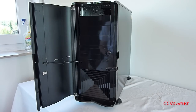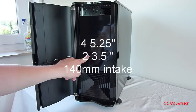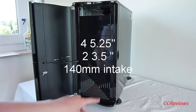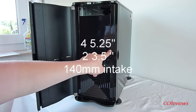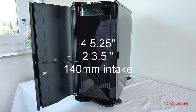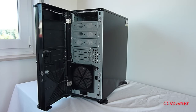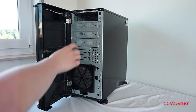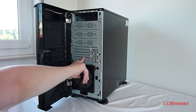On the front door, behind it, there is a 10cm long blue CCFL that gives a very elegant lighting on this case. The front panel reveals 4 5.25-inch drive bays, 2 3.5-inch external drive bays, a power button, reset button, hard drive activity LED, and power LED. At the bottom there is a 140mm intake with a special design to provide more airflow to keep your computer components cooler. The front panel can be opened even further where you can install the 5.25-inch devices and the 3.5-inch devices.